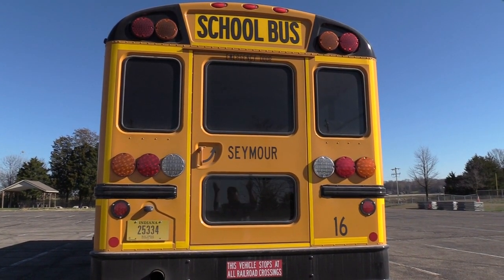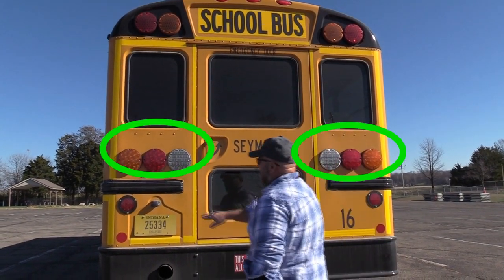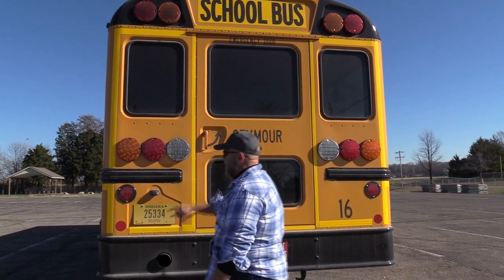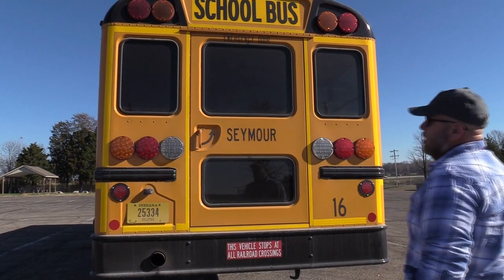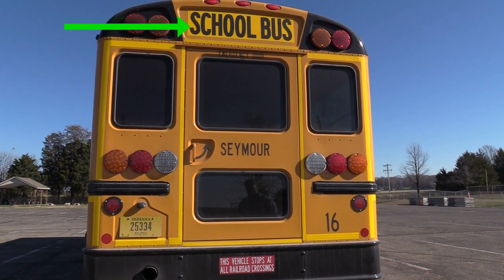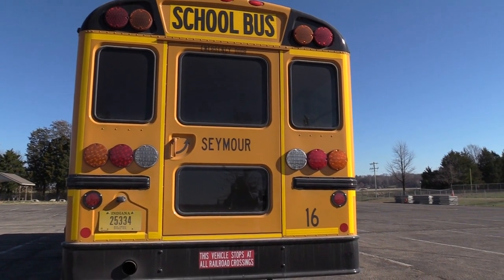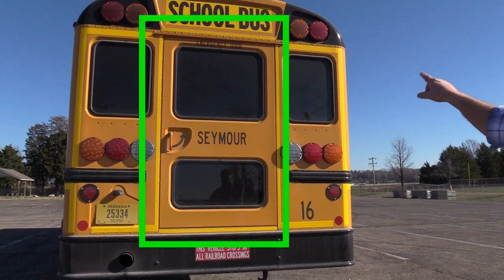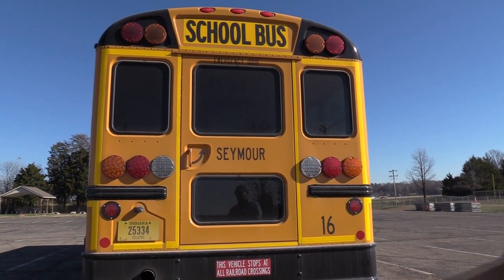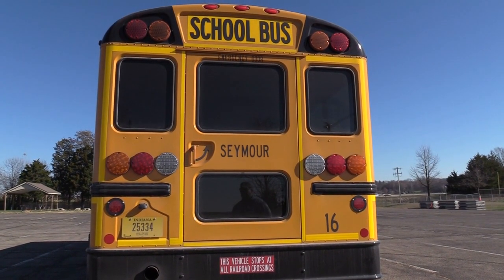I'm going to check all my lights: my clearance lights, my student overhead flashers, my turn signals, taillights, backup lights, brake lights, reflectors, and license plate lights. I'll make sure they are not cracked, broken, or missing and that they are the proper color. I'll check my school bus sign to make sure it's in good condition and readable. I'll check all my windows to make sure they are not cracked, broken, or missing. I'll check my emergency exit door to make sure the door is labeled properly, outlined in yellow reflective tape, and the hinges and seals are in good condition. I'll check my license plate to make sure it's in good condition, up to date, mounted, secure, and readable.